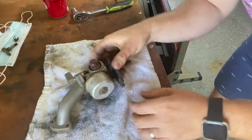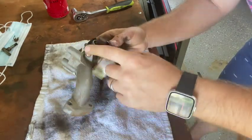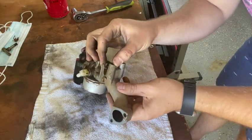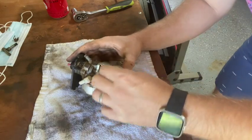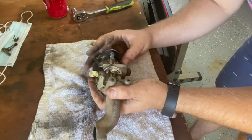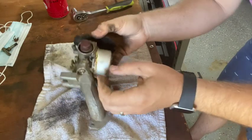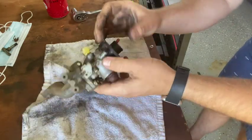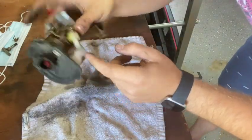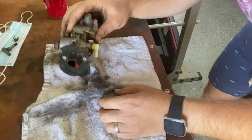Here she is. With these Tecumseh engines generally I like to keep the intake on because it has the RPM governor spring here. If you unbolt it, it's just another thing to put back together. All we're going to do — I checked the primer bulb, I don't see any cracks — so we're going to keep that. We're just going to take off the bowl and check out what's going on. We can do a little test: see if it blows air when it sits up, then put it down and see if it still blows air. I think that's why they threw this away — it's probably leaking gas.